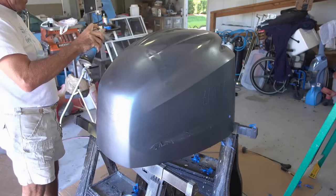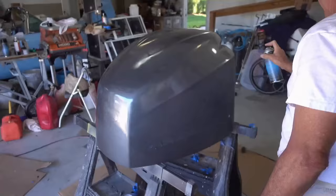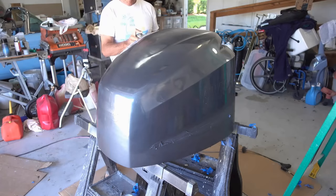Now onto applying our clear coat — all painting rules apply. This is the stage in which you have virtually no ability to recover from drips or sags, so just leave them. Once again, we are going to apply two good coats of clear, but this time with no sanding in between — they'll pretty much just be back-to-back coats. Once the clear coat has been applied, this is what the finished product should look like.